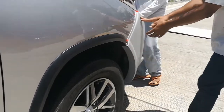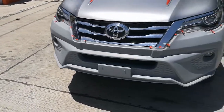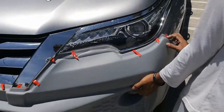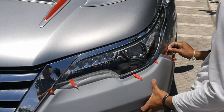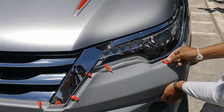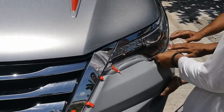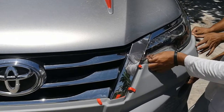Make sure to keep the 3M liner pulled outwards of the bumper cover. Make sure to align the front bumper cover with the car's surface. Pull the 3M tape liner slowly and steadily from one side to another. Don't pull very quickly — it will tear the 3M liner. Use the other edge peeled off of the liner to pull the 3M out.